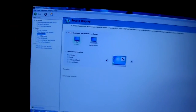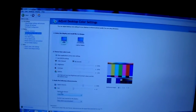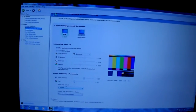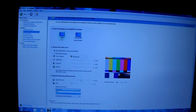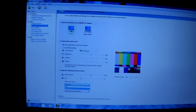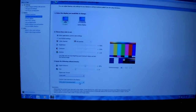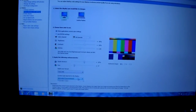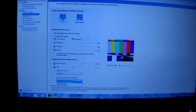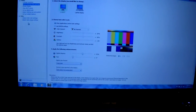Let's check resolution and set the desktop color. Go down to the bottom here — if you're using NVIDIA, this is what you want to select. YCBCR444 is a better color format. It has settings for RGB, but it's just not as intense or as vibrant as YCBCR444. You can do a little research on that — it's complex. But trust me, this one's a lot better. It's going to ask if you want to select for desktop and programs or for screen videos — it's best to leave this in auto-select mode, as your home surround and TV will do what they see fit for the best quality image.